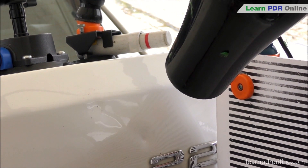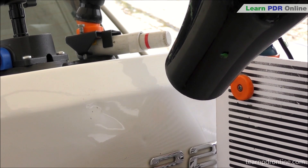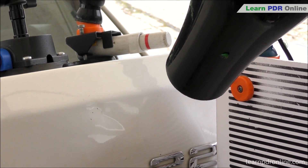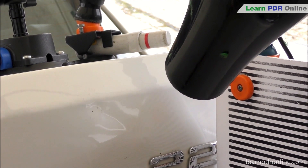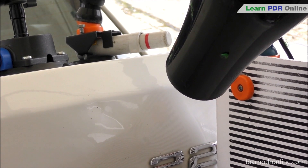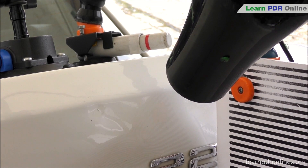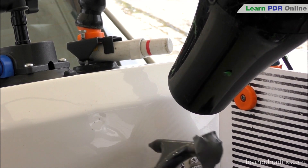You have to be very careful when working on deep dents or stretched metal to avoid overstretching the panel. This comes down to very precise pushes and being controlled in the area you're working on. You don't want to overstretch the metal - this can result in a process known as oil canning, where the panel is weak and the dent can just pop in and out. At that stage each push pops it out and each tap down pops it in, so you're looking to shrink the metal rather than overstretch it.